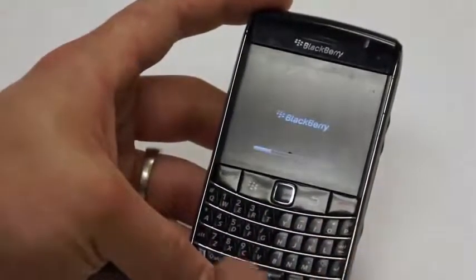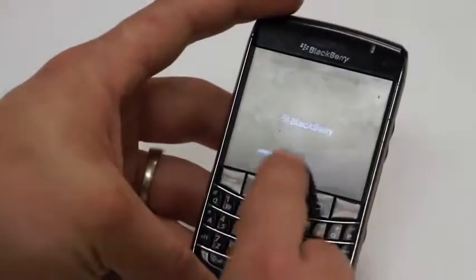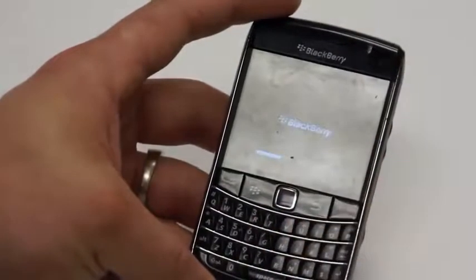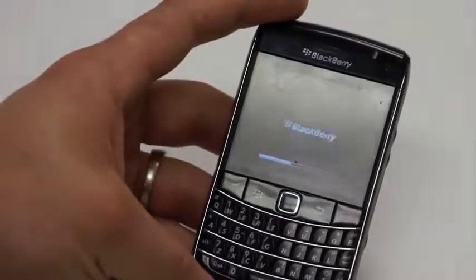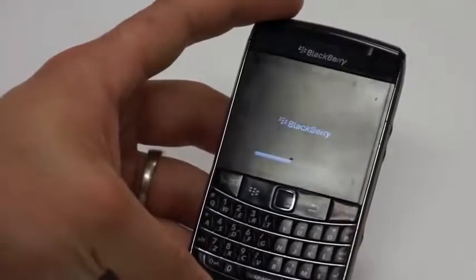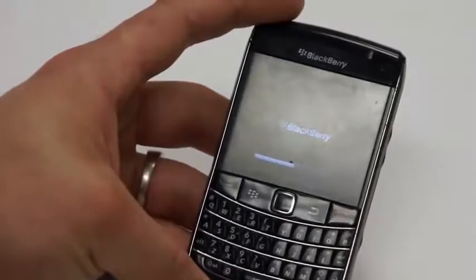There's actually 2 different versions. There's the 001 and then there's the 002 on these, and the more common one is going to be the 002, but you actually really don't know what it's going to be until you physically disassemble the phone and look at the back of the LCD, right. And you will have to dismantle the whole entire phone to get to that, unfortunately. But once you do find that number, you can just get the right LCD and everything will work fine.